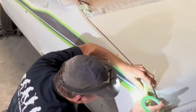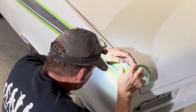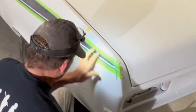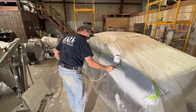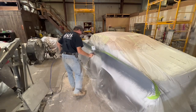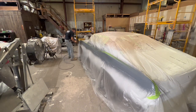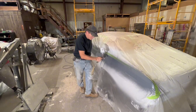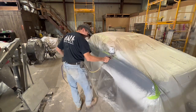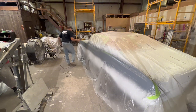There was a time when I didn't need a bright light like this and I just zipped through this job, but those days are gone. I'm just happy that I can still do it. It's 50-something degrees today so this waterborne primer takes a lot of flash time — like 20 minutes in between coats. This is the second coat that I'm putting on. It's gonna be cold and rainy for a few days so we'll be letting this dry for those few days, so please hit the like button and subscribe!